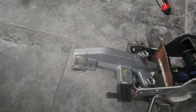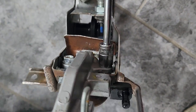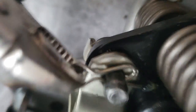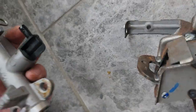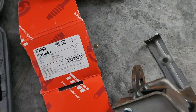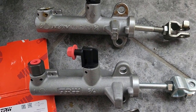With the whole clutch pedal assembly off the car, you can see the little clip we undid. There are two 12mm bolts that hold the cylinder onto the assembly itself. On the other side you might need some grips, but there's a little circlip you can pull off on the pin — that's what holds the end of the master cylinder onto the pedal bracket. Once those are done you can pull it out. Some of these are listed quite expensive, but I got this TRW part for about £30 rather than the £100-plus I was seeing elsewhere, and it's exactly the same part.